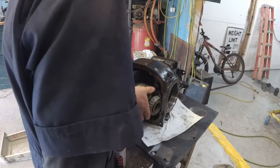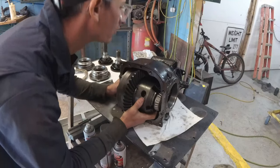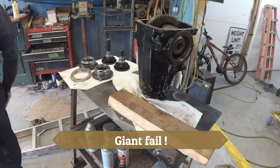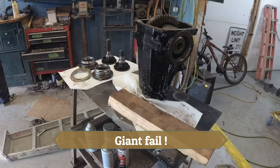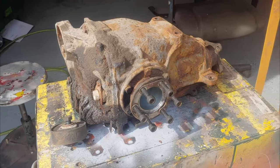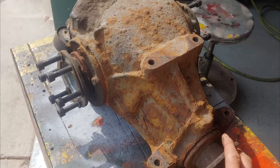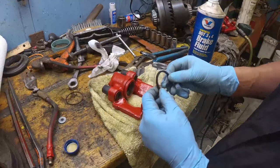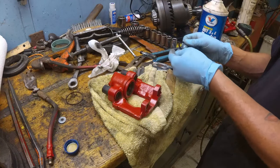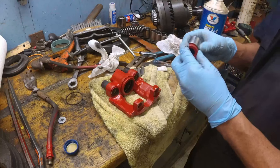The carrier didn't fit at all. I messed around for a long time before I gave up — but ultimately I did give up. I found a guy who had a 2.93 gear ratio differential in Wisconsin, drove there, and bought it. It's got a clutch LSD and is in pretty good shape — looks nasty but I'll have it all cleaned up by the next video. I also cleaned up, painted, and rebuilt the rear calipers. I would have just bought new ones but I'm just too poor for that.